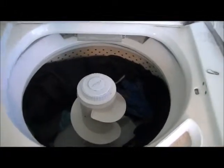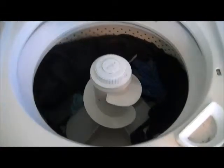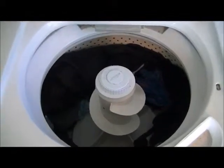The clutch drum is on top of the transmission, basically underneath the agitator, right in the very center. It should not turn at all during the agitate cycle. And the basket drive — the drive block and the drive tube — those pieces are also not supposed to turn during agitation.